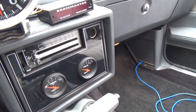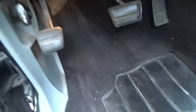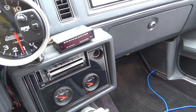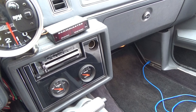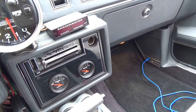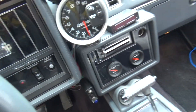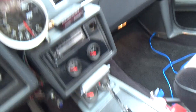As far as your 12 volts go, you've got to come down to your fuse box and grab either a test light or a voltmeter. What you're looking for is 12 volts keyed on ignition. Turn the key on, and when you've got 12 volts battery voltage, that's the one you want. You don't want a steady 12 volts for this because it'll just stay on.